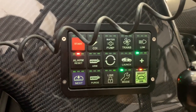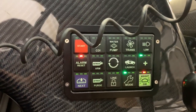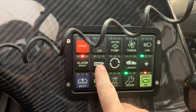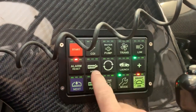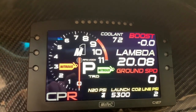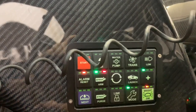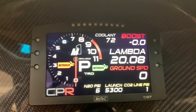Sometimes we're in the staging lanes for a long time and lose nitrous bottle pressure because the heater is off. Generally it'll just hit 900 or 950 PSI and turn off automatically in the M1, but I wanted to create an override. If I hold this down for about five seconds, it turns on the nitrous heater — you'll also see a red light here which means the bottle heater is running, and there's an amp draw on it as well.